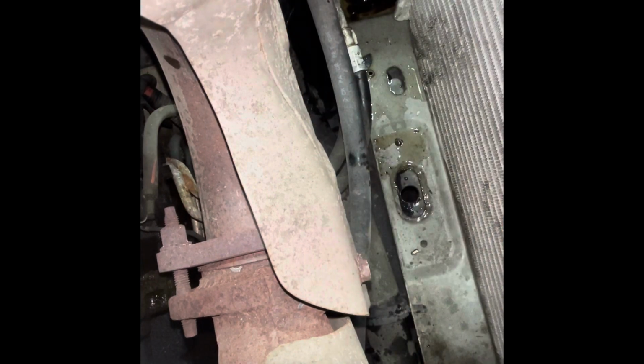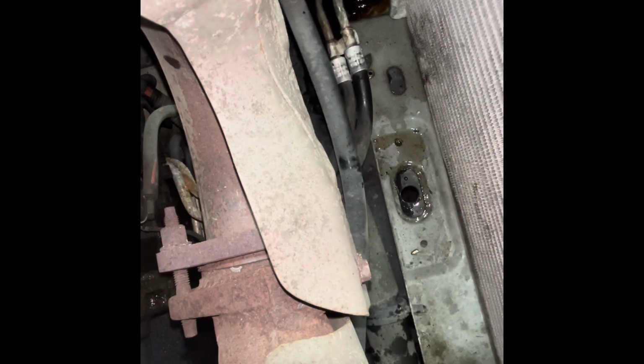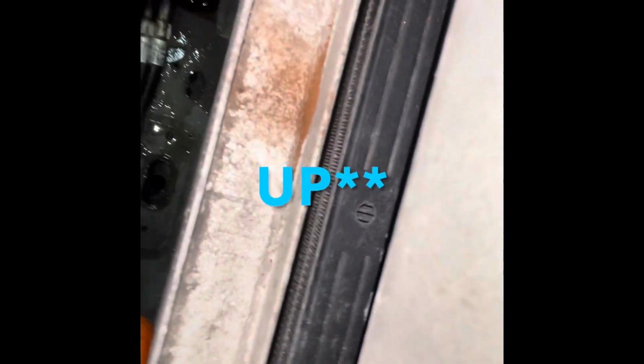The only thing we have left to worry about that is sometimes difficult is how the radiator is attached to the AC condenser behind this. Well, in front of it, because this is the front of the car. So it is also hooked in. So we're gonna reach back here and push down on this second radiator looking thing. Oh, sorry guys, I lied. There's also a 10mm bolt here that secures the lines of the AC condenser. Really quick.